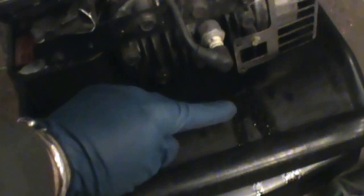I pulled the three bolts out of the starter assembly and we'll pop that right off. Under there we can see the flywheel, and I've got to tell you I'm happy to see this oil down here - that to me is a sign that there's a problem with the head gasket, so I'm kind of hoping that's what it is.